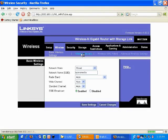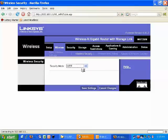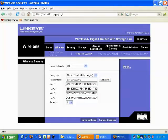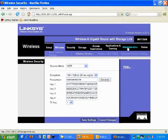After that, we'll go to the wireless security. We're going to make it WEP since it's the easiest. It's not the safest, but for home use most of the time it's okay. You can give a unique passphrase that you want to share between the other people on your network. We're also going to do 128-bit encryption since it's a little bit stronger than the other type. Then we click generate and it'll give us unique keys that we can use for each computer. These can also be used on other computers other than four. Then click save and the settings are saved. You want to save each time because sometimes when you switch tabs it won't save, so it's a good precaution to do that anyway.